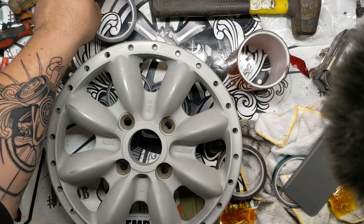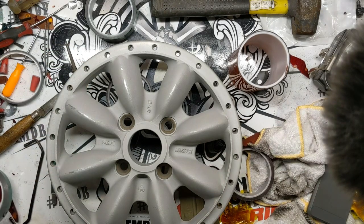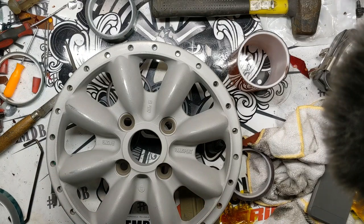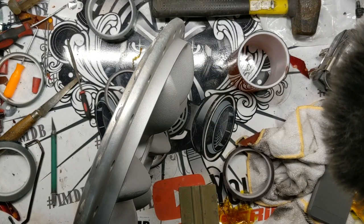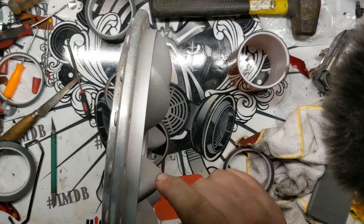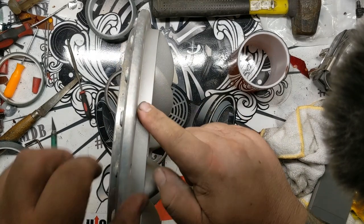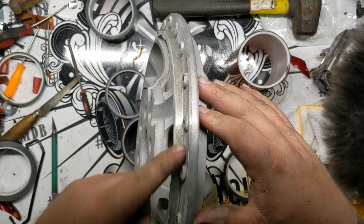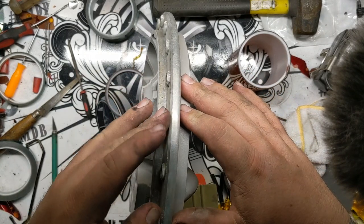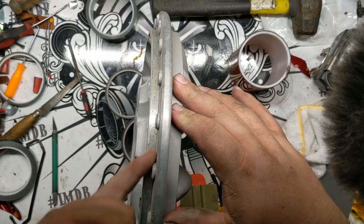These wheels are a little bit different in the way that they're set up. Now I don't know where my other roll of tape is. So these wheels are essentially two-piece. They go into a one-piece lip and barrel combo. So we're going to tape off this flange right here all the way around, and then this area here. These actually are threaded steel inserts. I intentionally didn't blast these because they have an anti-corrosion coating on them. So we're going to tape all that off.